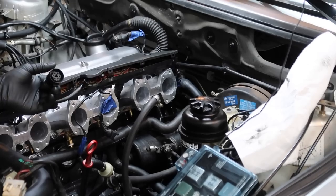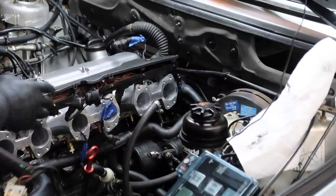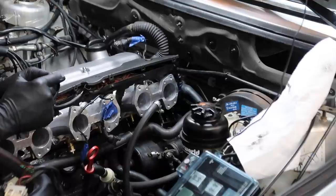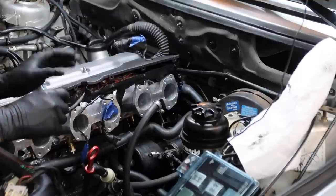This obviously does not work. The throttle bodies use an M50 style one, which I have to find. But what's nice is you can actually use the three existing wires out of the six that go into this plug, and you can run your manual throttle position sensor off of it. So the round plug is going bye-bye.